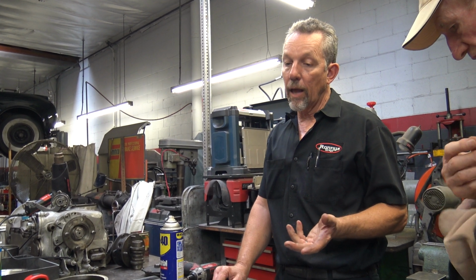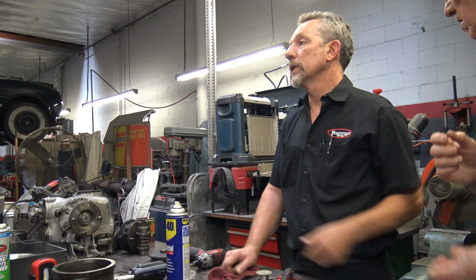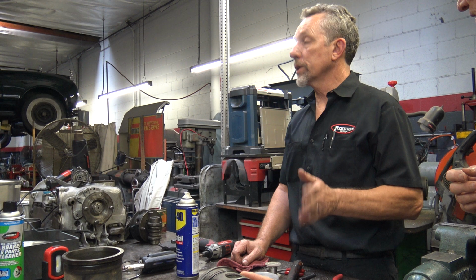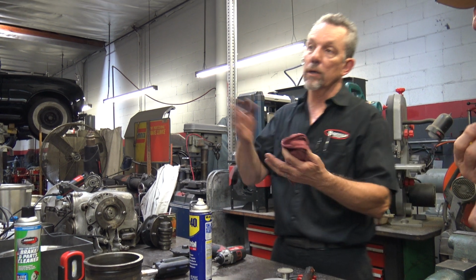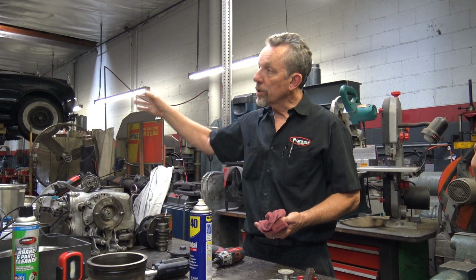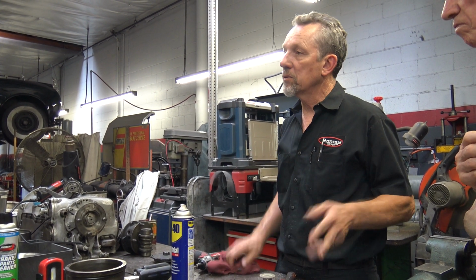And I said, we can put some rings on these, rehone this, and it'll probably not smoke anymore, but you're going to have that knock in the engine. We can't get rid of that. And he wanted it done right. And I said, well, it's a lot of money, but this car I think is worth it because it's a good car. If it were a rusty old driver like my old Bentley, then I would just leave those in.